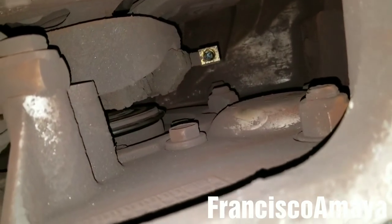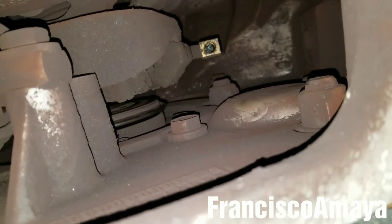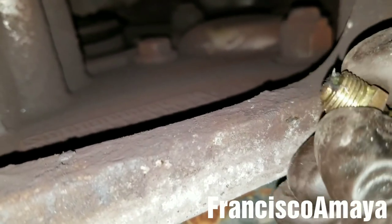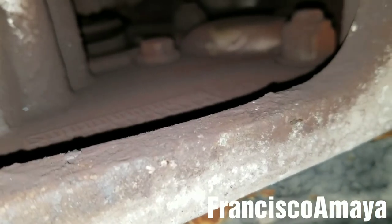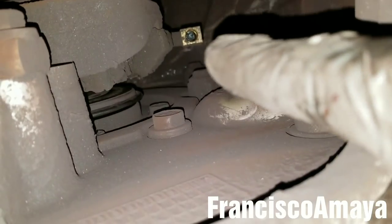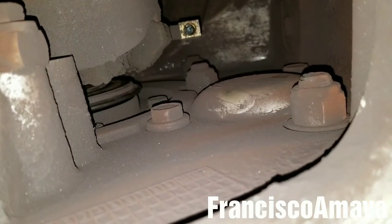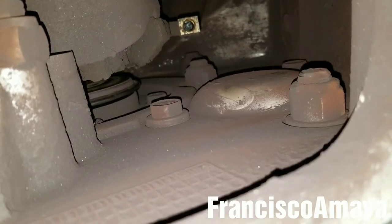So now what you're going to do is place a new hose — you can go to the dealer and buy the new hose. But there is another way, which is to install this grease nipple. This small grease nipple is cheaper than the hose. All you've got to do is align it and install it on the bracket on that tube and tighten it with the same 11-millimeter or 7/16 wrench. It's very easy.